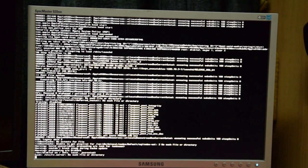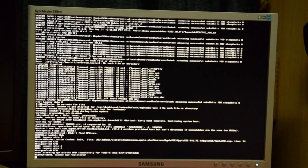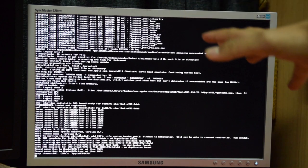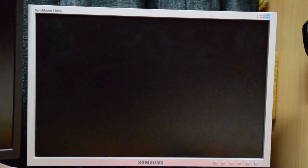Just click Space Bar, enable verbose boot, and click Enter — and as you can see the problem is gone. If you know how to fix that problem please let me know, I get really frustrated with it. It got into a problem again, which I'm pretty sure is because the Clover config isn't right. I'll go back into Windows, change the Clover bootloader, speed that part up really quick, and then show it booted. I'll hold the power button since it says 'power timeout', then power it on again and spam the Escape key to boot into Windows.